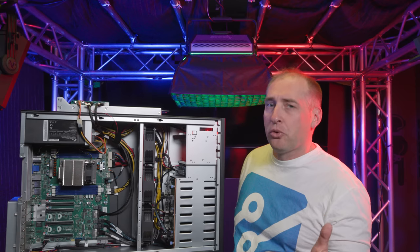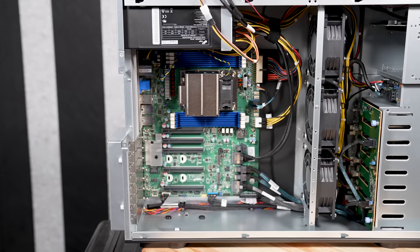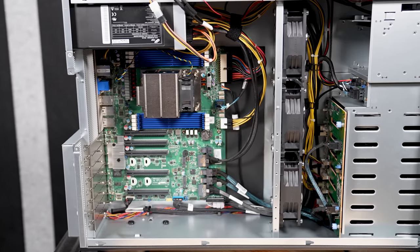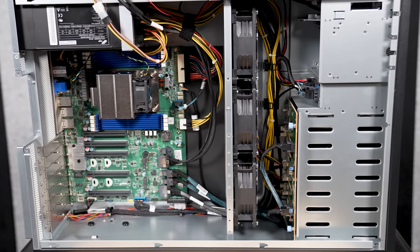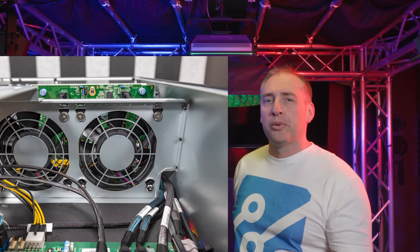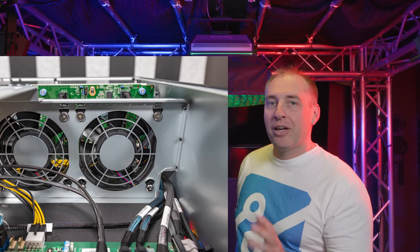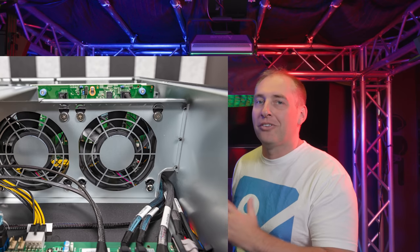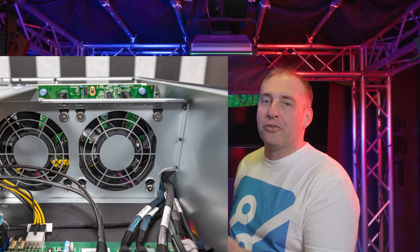Inside the system, we've already talked about the storage backplanes. The next feature is really the fans. This system, even though it's a giant system, has only three fans in its primary partition — a lot of 4U servers have just tons of fans, but not this one. While these fans are not on hot-swap carriers, Tyan did something interesting: they put a total of four rubber grommets on all of these fans and a little mounting system so the fans mount in the chassis with vibration isolation and can be fairly easily swapped out if needed. You'd probably still need to take the system down to do it, and fans these days are super reliable, so you'll likely never run into that issue.